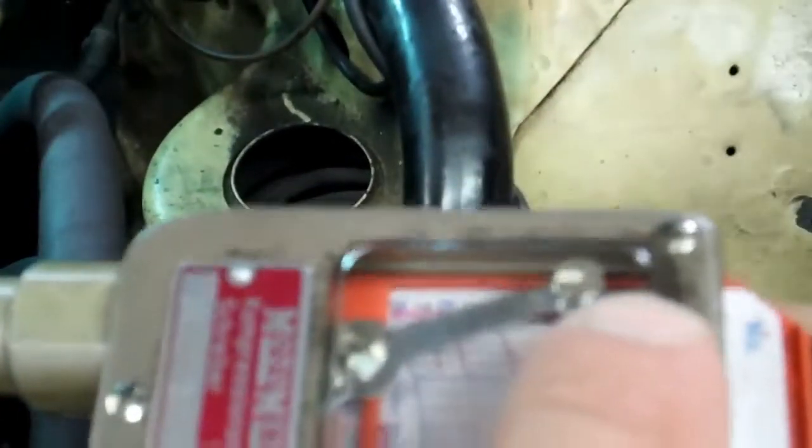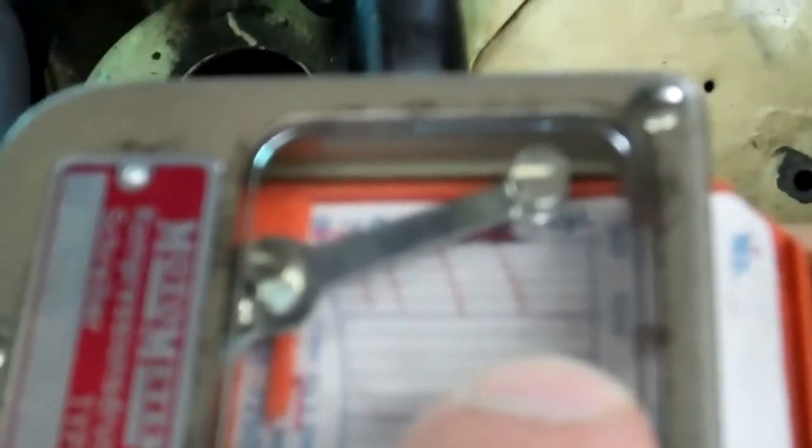We're going to crank it right now — and the needle did not budge at all. You can see that the other four cylinders left a red line to indicate compression in those cylinders, but cylinder one has absolutely no compression, which means the engine is bad.